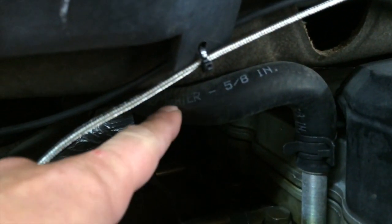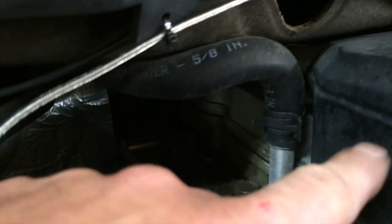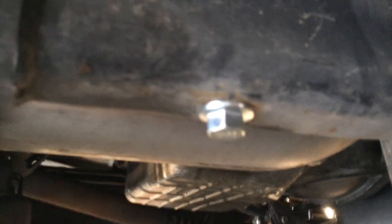Here's the heater hose down here - this is where I'm going to end up sectioning out an inch so I can put my T-fitting in with the two hose clamps. You leave all the stock lines coming out of the head and just cut a section right about here. Then go down to the frame rail. There's your bracket with the supplied bolt - it uses all factory holes, sets right in place. Tighten up the bolt - I think it was an 18-millimeter wrench - and we're good to go.